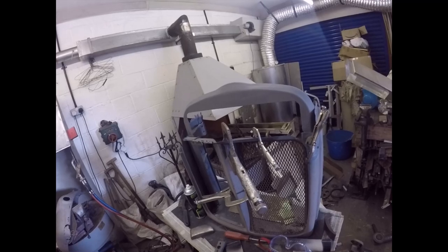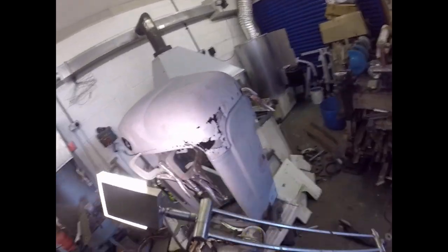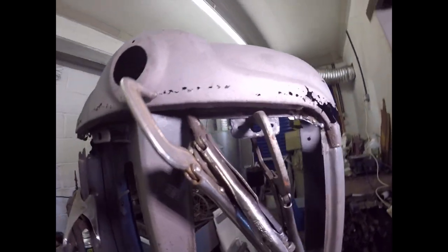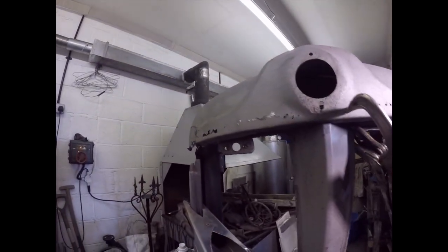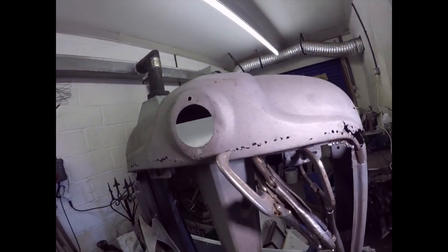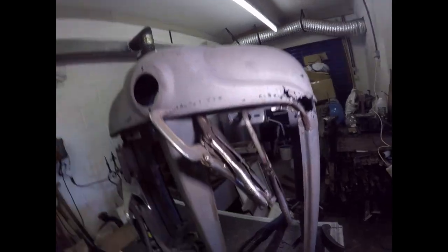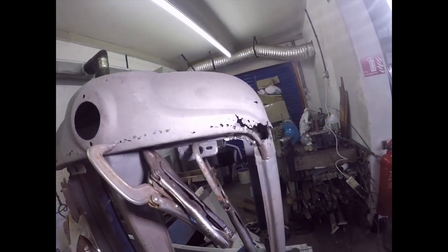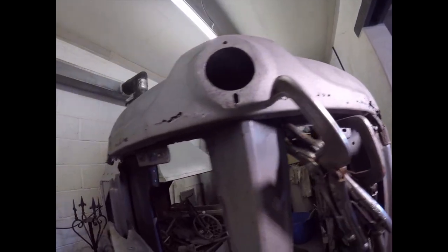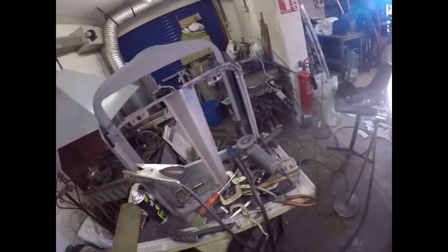I got broken off by an overheating Volvo, but that's fitted — it goes on there, meets up there, meets up under there, so we're looking good. I'm going to have to reinforce this edge and repair this as well, but that's minor — I just need to put some metal behind it and spot weld through the holes. Just putting a few more spots on there, then we'll move to this side and start on here.